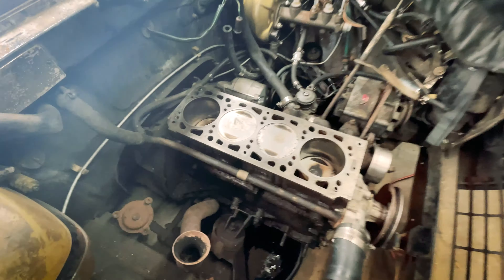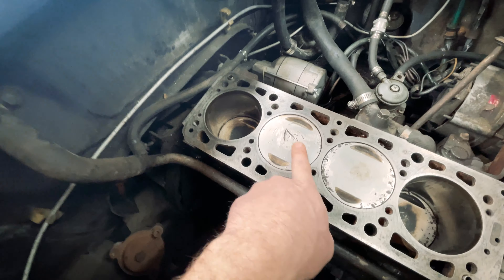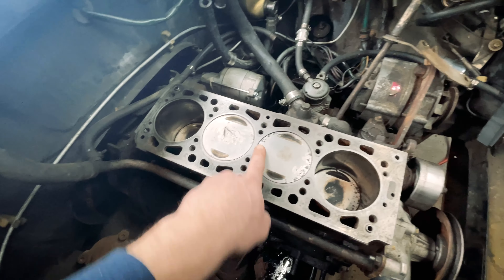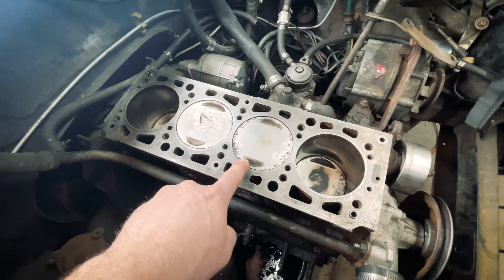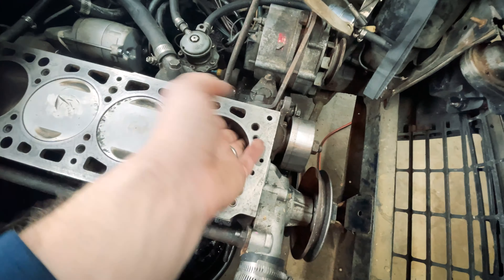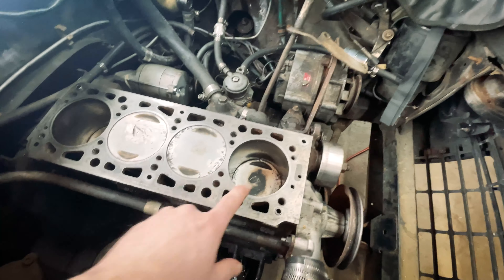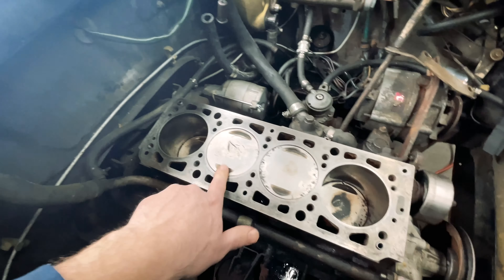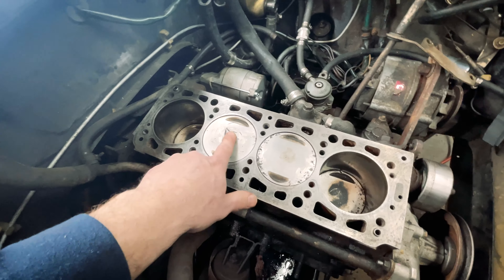When we look at the corresponding damage - I was able to clean the block off and take a look at the pistons - they don't look good. You can see there's definitely some damage where that valve broke and hit, and you can see how the pieces of the valve seat shattered like glass and just ripped chunks out of both of these cylinders. Now surprisingly, the cylinder walls on all of them are very smooth. I think basically the fragments got embedded in here and then didn't move. I've ground down a little bit off some of the high spots and I don't see any holes that go all the way through.